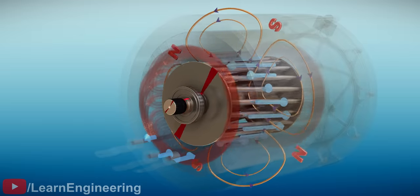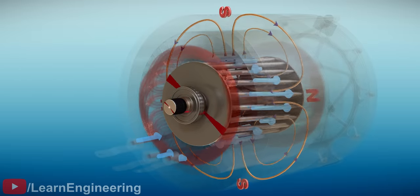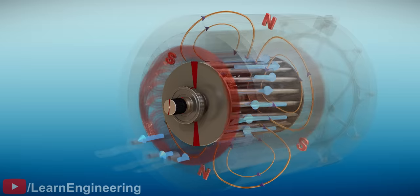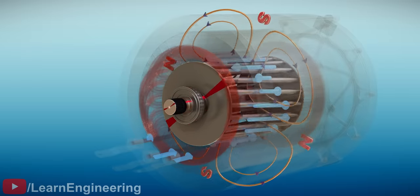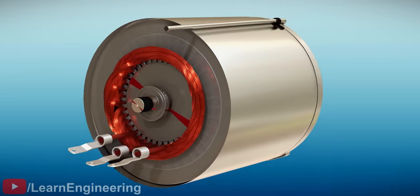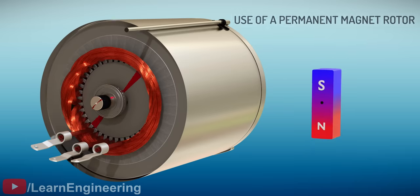These motors are efficient, but not up to the mark. For instance, long drives at cruise speed lose 3% to 4% of energy to generate currents in the rotor bars, which is definitely not efficient. Moreover, for an automobile, the most crucial performance parameter is its starting torque. Even though induction motors have a better starting torque than IC engines, there is a motor technology that provides even better starting torque from the same motor volume — a motor technology based on permanent magnets.